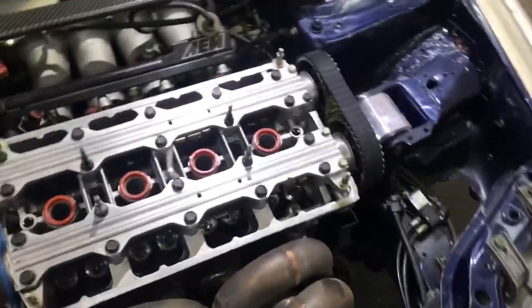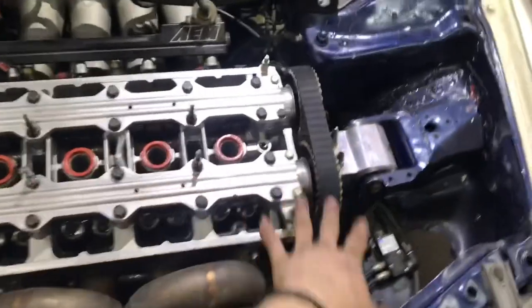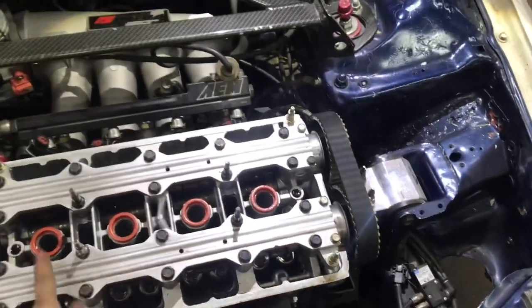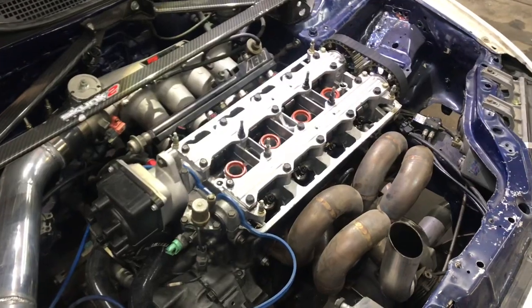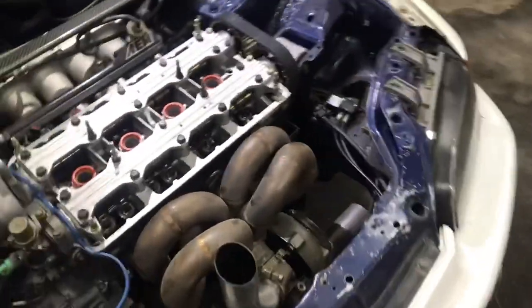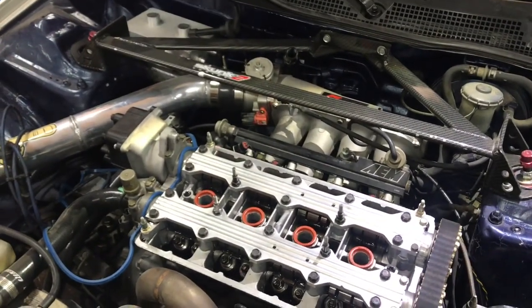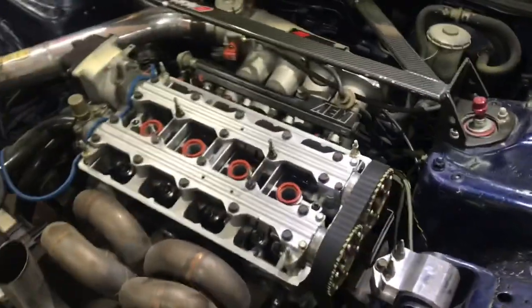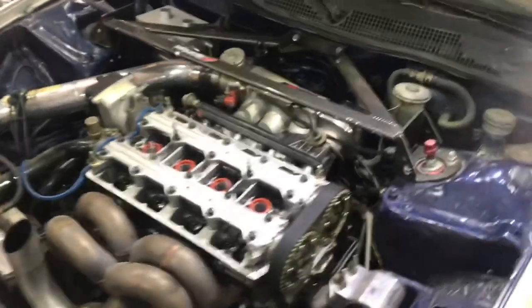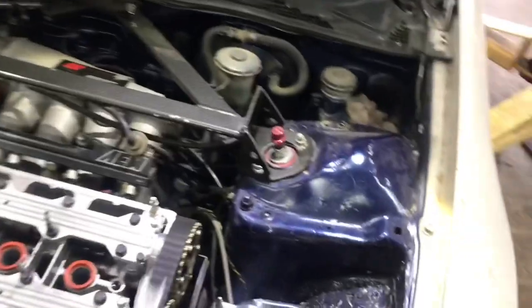So I thought I clicked start but I didn't, but we did the compression check and this one was 150, 147, 150, and 160 — so all the cylinders are good, all have compression. I'm just going to button it back up, get it back together, and see if it fires up. If it fires up we'll send it back home to him. I mean it's been sitting in his garage for two years because he ran a rag through it while cleaning it. You've got to be careful cleaning your motor — if you're cleaning the valve cover I wouldn't recommend doing it with it on if you don't have a timing cover. Those are important.